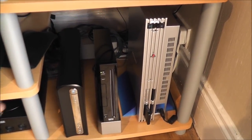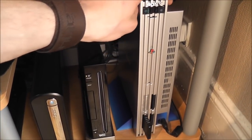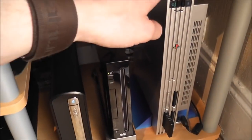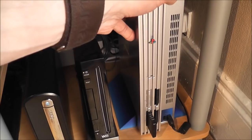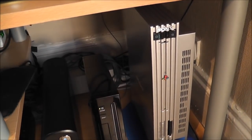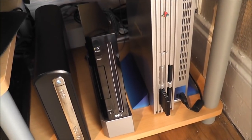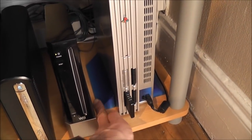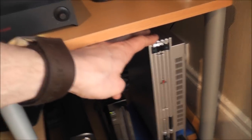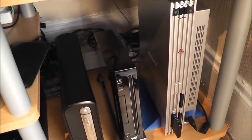First of all we've got the PlayStation 2 — this is the original fat version of the console and it's the silver edition. I got this on eBay for £10 delivered. It was a faulty console but the only thing wrong with it was a dirty laser, so that took me about 10 minutes to fix and it works fine now. It's also got the blue stand and the little silver camera. That's plugged in with RGB SCART so you get a nice clear picture from it.